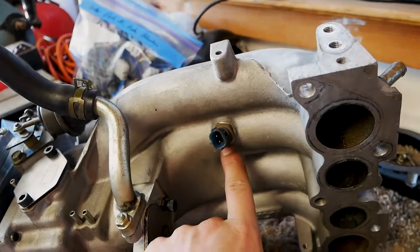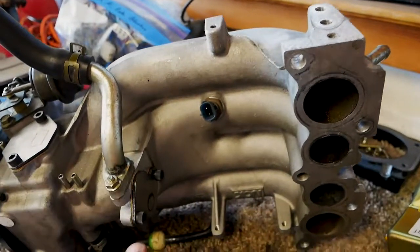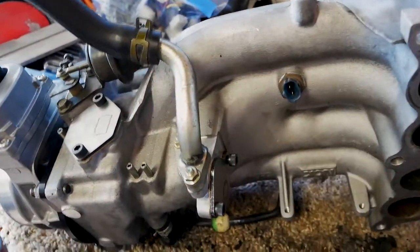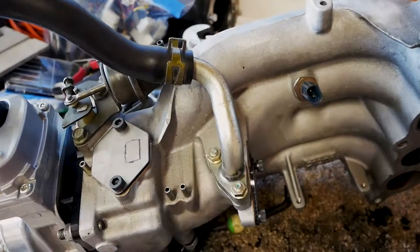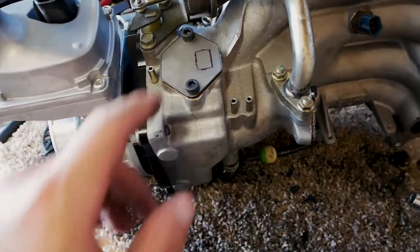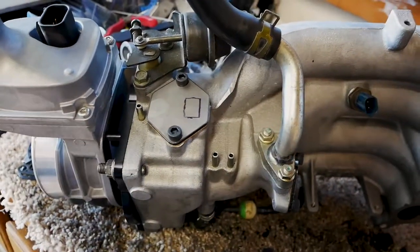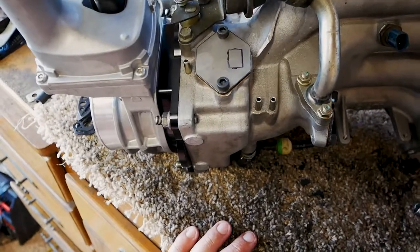I'm going to have the LMS EFI fast-acting air intake temperature sensor here. This is going to be a block-off plate for the MAP sensor. There's a MAP sensor that's going to be in front of the throttle body and one behind. Depending on what works better — this hole or this hole — I'll put the MAP sensor on either side and self-test to see what flows better to get a more consistent MAP result.